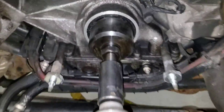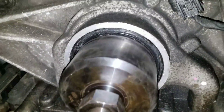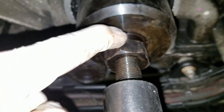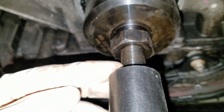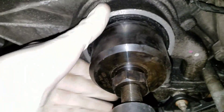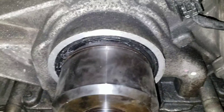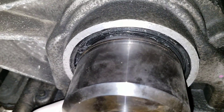Just want to give a little video of this thing coming out. So the tool is tapered and it screws into the crankshaft seal, then it's got a bolt that just goes on the nub of the crank and is going to pull against the crank with this screwed into the seal. I got it all hooked up — it's about a quarter of the way out — so here it goes.